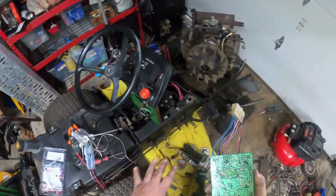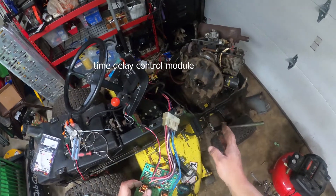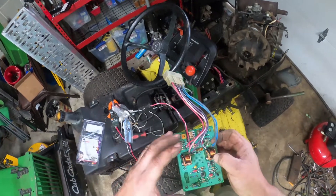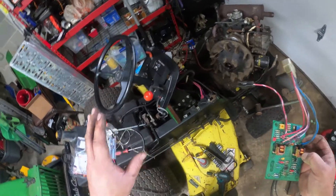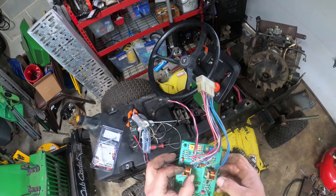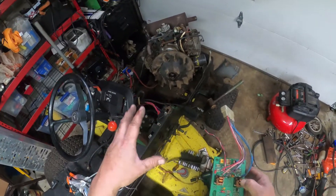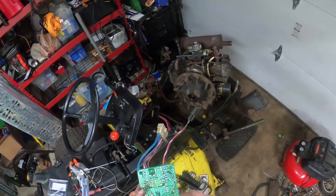When all the gates are closed, this allows the unit to actually transmit an electrical signal to the ignition module so that the unit will fire and run. It's a safety gate - once the completed circuit has been closed, covering your seat safety switch, PTO safety, and things like that, this unit would open so the electricity would flow out to the starter and ignition system, allowing you to run current through the ignition module.